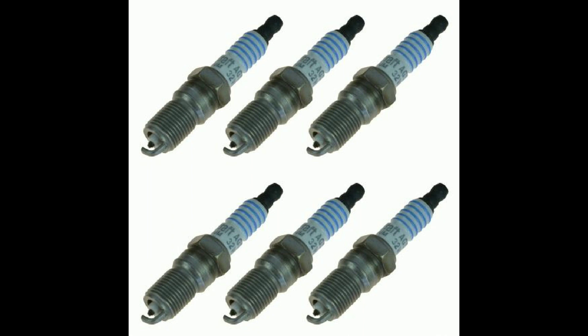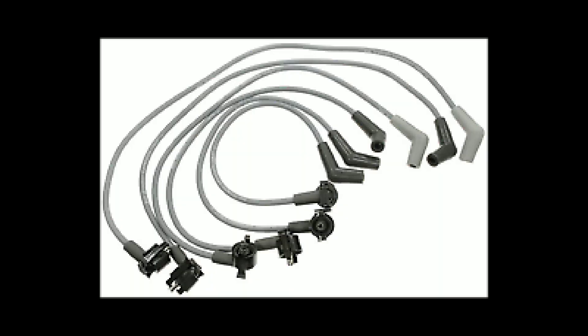The 3.0 liter cast iron crank will handle quite a bit. There are Vulcans that make over 240 horsepower on a cast crank. The secret is it will not tolerate any detonation with the increased horsepower — it will fail. You must do a solid buildup and seriously address detonation with water injection, no sharp edges in the cylinder or combustion chamber, ceramic coatings, etc.